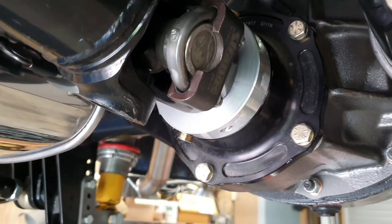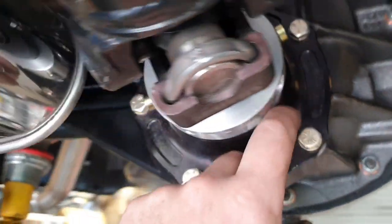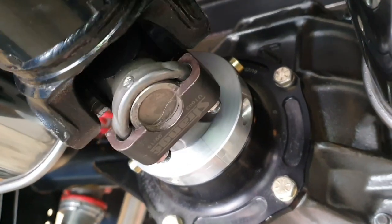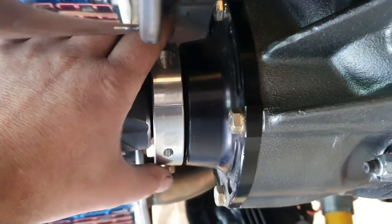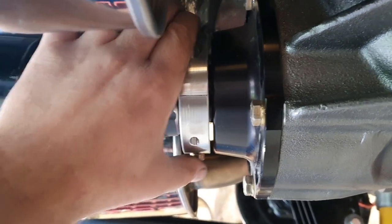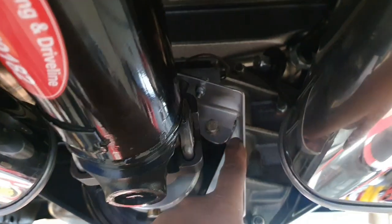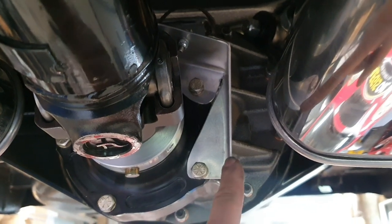Just orienting the collar correctly — that's forwards. Now I'm making a bracket catching that bolt and that bolt, putting it up the top where it's nice and tidy and out of the way. We'll use one of those generic Hall effect sensors — they cause problems at high frequency but at low frequency they're fine. Instead of measuring 36 times per revolution of the motor, it's measuring two — well, depending on gear. In fifth which is one-to-one it'll be two times per revolution, which it should handle no problem. It's past knockoff time but the bracket's done — I'll get it anodized or painted.